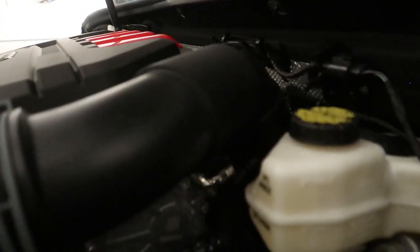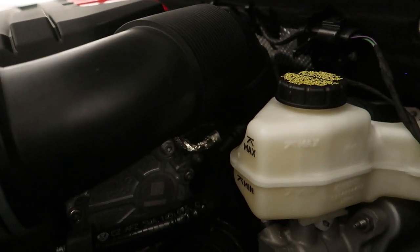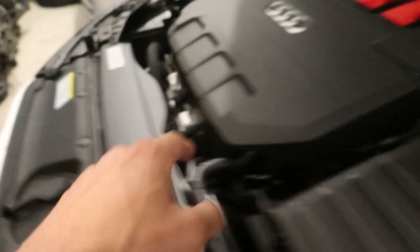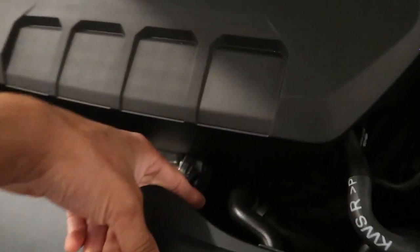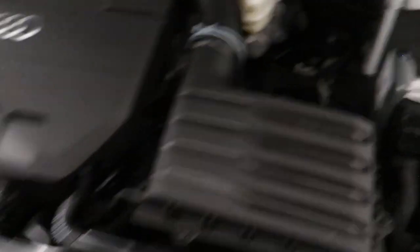The Mark 8 GTI is the same as the Mark 7, but the Mark 8 Golf R and the S3 — the diverter valve is relocated to the throttle body down here to help with throttle response. And that dumps into the inlet up here. The inlet is really small. Sorry, I got terrible lighting, but it's down in there. I think the hose and the intake will just fit right in there.